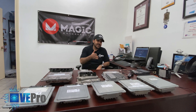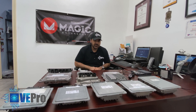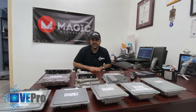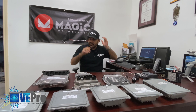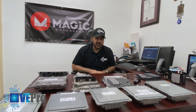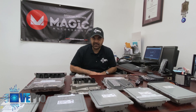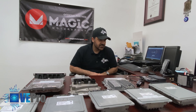A lot of people are asking how to get the ISN out. Believe it or not, Flex has the capability of getting the ISN out of this ECU by OBD, and we are going to show you how that's done. As well, you are able to read the full data of this ECU on the bench, and we are able to extract the ISN information from that file as well. So let's get to it.